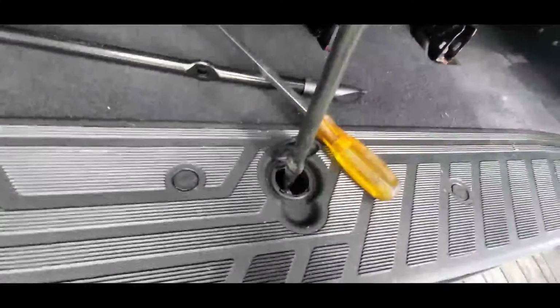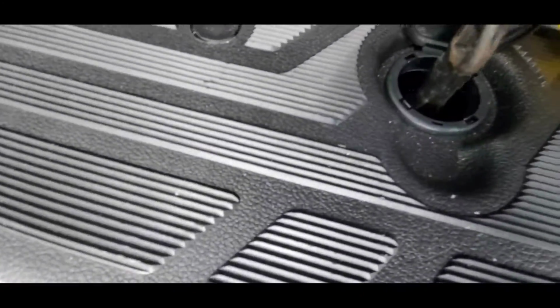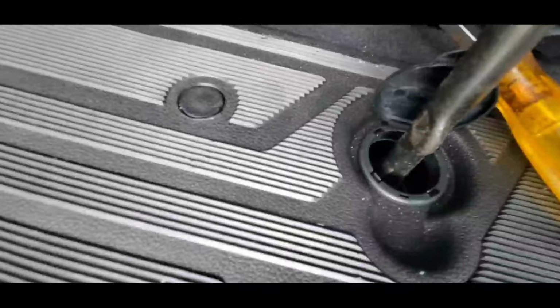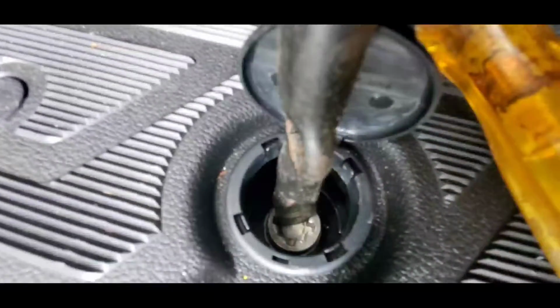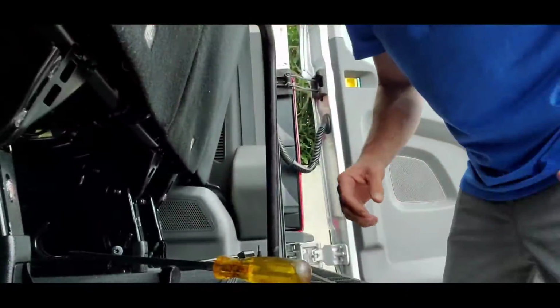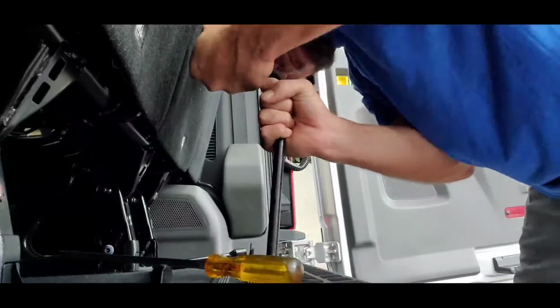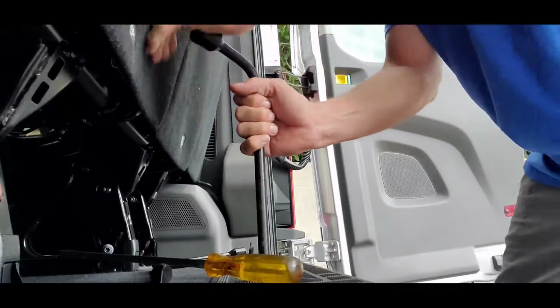And so then I put this tire iron that I have in here, and you can see that it doesn't really fit in there either, right? It won't go from side to side like it's supposed to. It's not wide enough. But if you cock it to one side, you can get it to fit a little bit like that, and then crank it. And then just crank it like that until the tire starts to lower down.